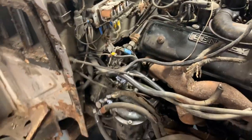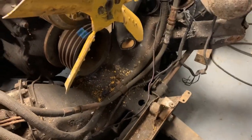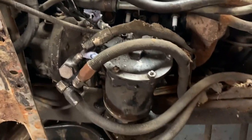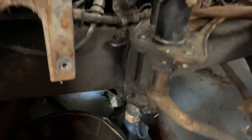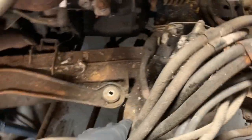I've been told it's better not to split the column from the steering box. This whole chunk here is the steering box, connected by hydraulic hoses through to what I think is the pump. I started taking the hoses off — getting ATF everywhere — and working out how to disconnect it. There's also a bottom arm going to the steering system, which I managed to get apart, and a torsion arm to stop the steering box twisting — that's held on a vertical spindle, so I've undone that as well.